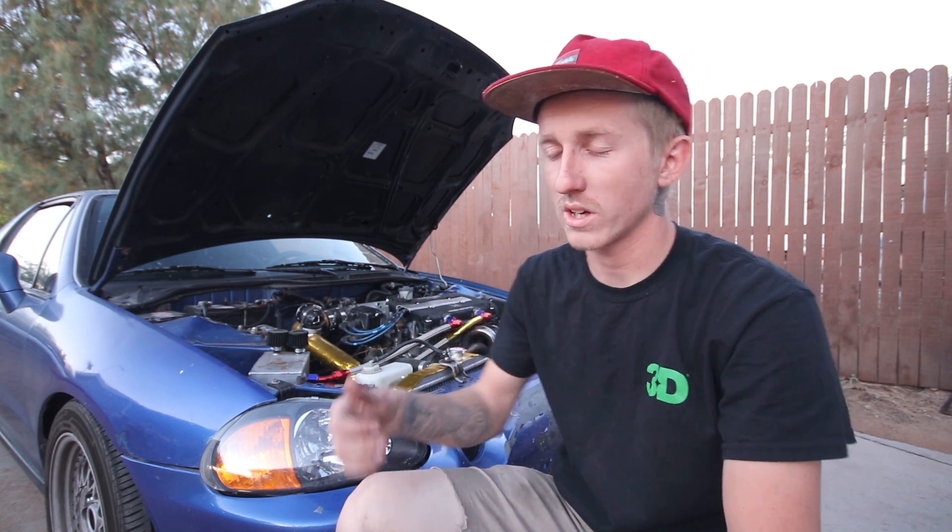As for the turbo, I started this motor off with a Garrett T25 — just like the stock SR20 turbo — and that didn't last very long. On that turbo I made five and a half PSI; it was supposed to be six pounds but it was a weak actuator. I tuned it on 91 at five and a half PSI and it made 211 wheel horsepower and around 180 to 189 pounds of torque — I'd have to look at my dyno sheet.